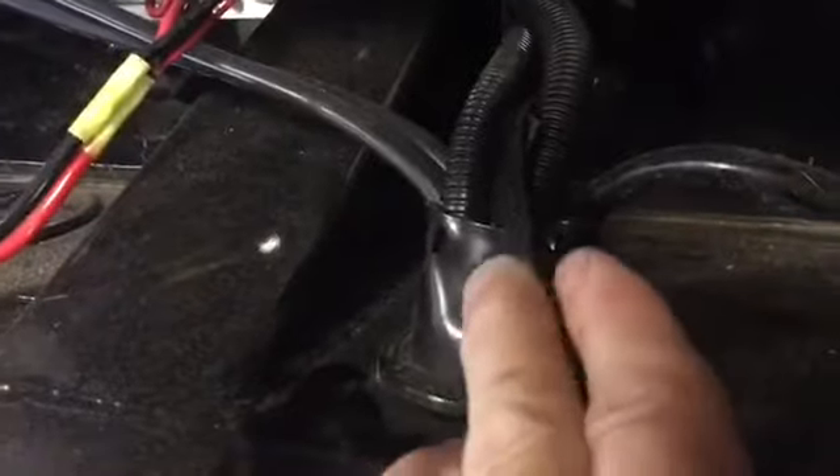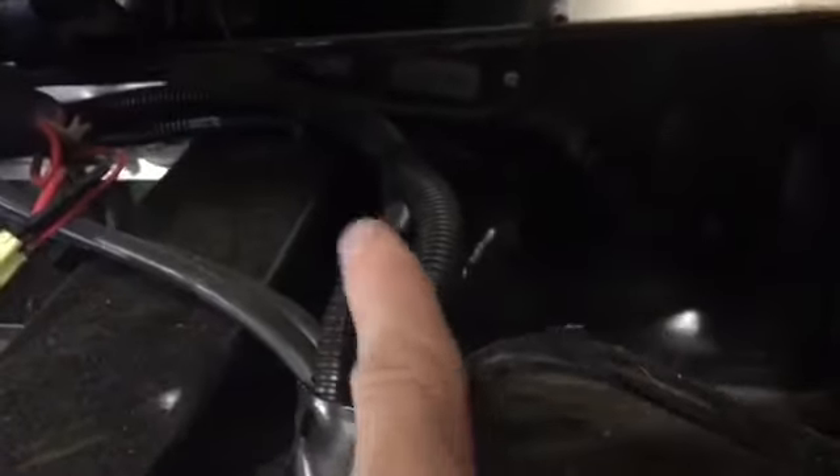What I did was I took those three wires and ran them up here to the back into this grommet. They come up through this grommet and I have them in wire loom — 3/8 wire loom — with those three wires together. I pass them up through the grommet and around up to the cables that go to the motor, and then just follow it all the way around, zip-tied to the motor cable and throttle cables.